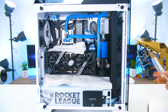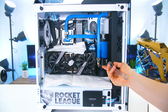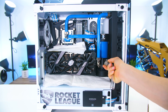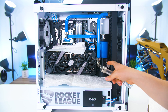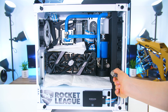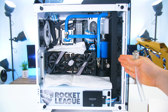When it comes to draining the loop, one thing I'd invest in alongside your water cooling gear is a bit of soft tubing and a soft tube compression fitting. This screws on nicely, and because the soft tubing is flexible, you can flex it down so the liquid runs into a bowl or container. The same can be done with hard tubing and a compression fitting, but soft tube is better because you can get it facing down so liquid drains by gravity. Hard tube isn't flexible enough to bend in certain ways, so I definitely recommend purchasing a bit of soft tube if you plan on maintaining your build regularly.